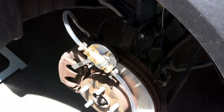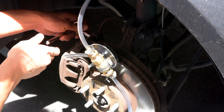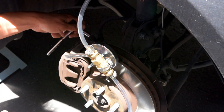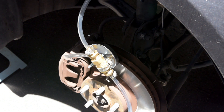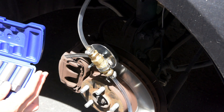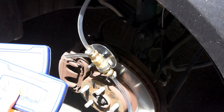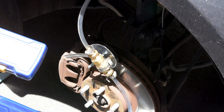I think I've got everything I need. First thing I've got to do is remove that stripped bleeder valve - we know it's a 10 millimeter, so we can try to get it off with the 10mm socket. I didn't think we'd get lucky, but we did! On the off chance I wasn't going to get lucky, I was going to use an extractor. I've got deep ones and shallow ones for just this particular problem - I've actually only used it once but they're good to have.